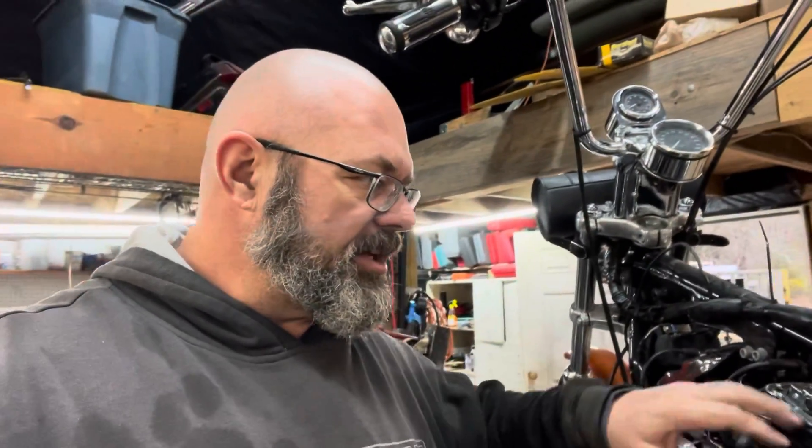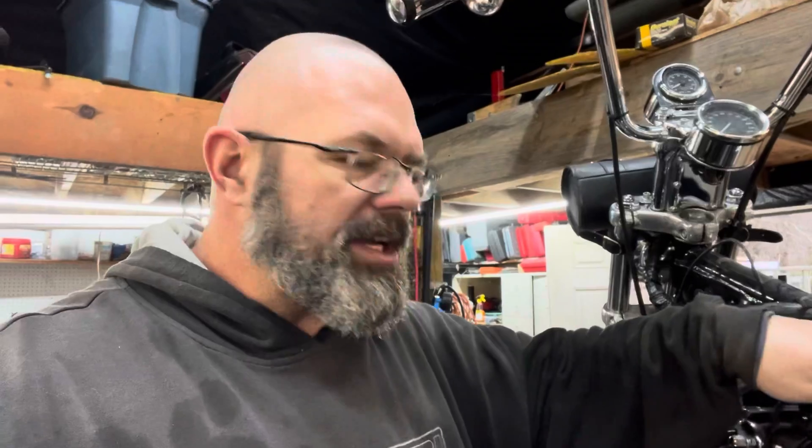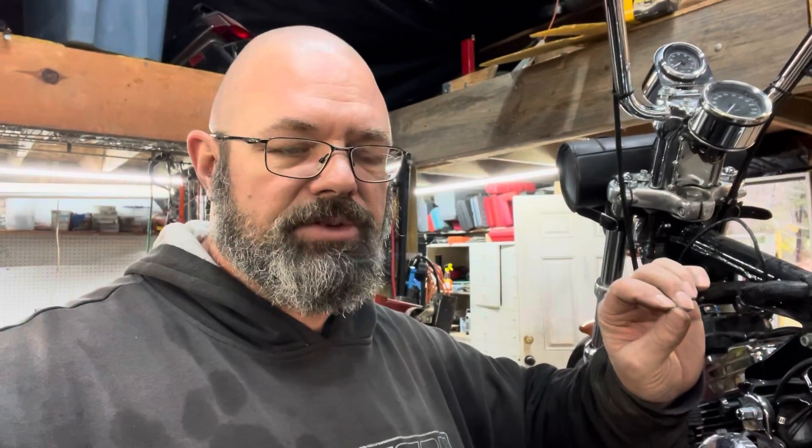Another thing I did is I put this rear cylinder on top dead center compression, because then the springs aren't compressed as far. You're not going to feel a slack in it like you would with a screw-and-lock-nut setup, because this does have hydraulic lifters, so there's still going to be pressure on the push rods to the rocker shafts. But as long as it's on top dead center, the cam is on the base circle, the valves are in their seats, and you're not going to be fighting the spring pressure — lowering the risk of doing some kind of damage.